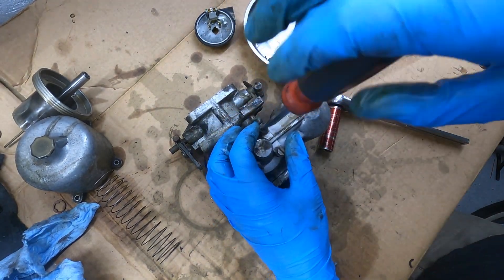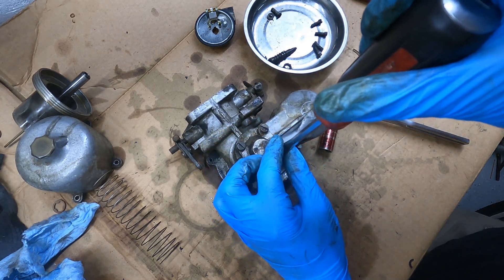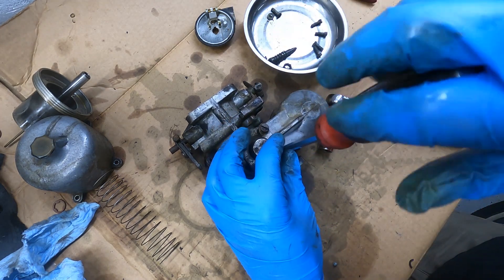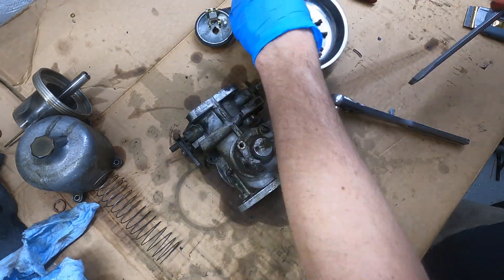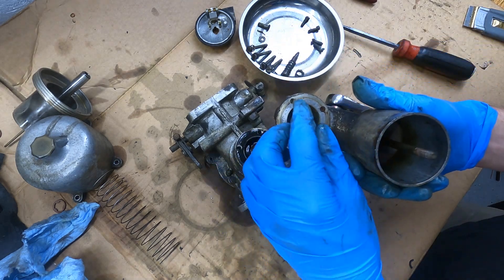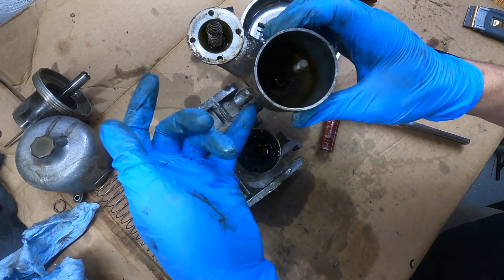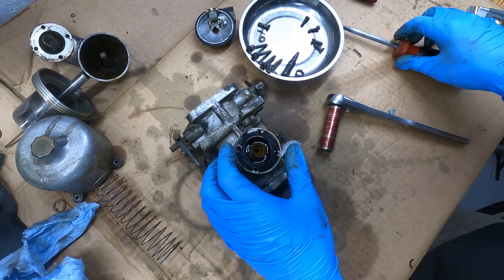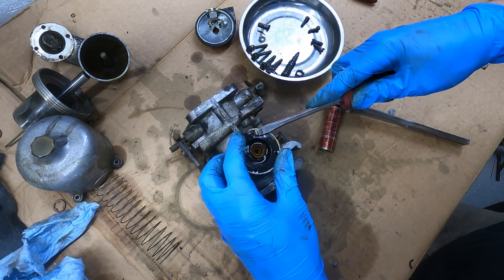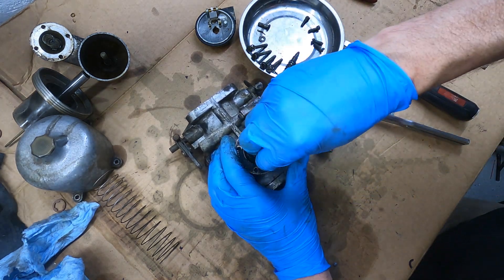This wasn't even tight — that's crazy. The fuel goes into this float area right here and then transfers via a tube into here where the main jet is. There's going to be a spring in here — you're going to want to clean this pretty well as it gets nasty from fuel sediment. Now we're going to get to this diaphragm. This one actually looks a little more flexible — the first carb I took apart, this just shattered like hard plastic. So that's a reason it wasn't working, along with the stuck float.